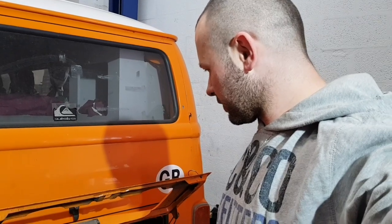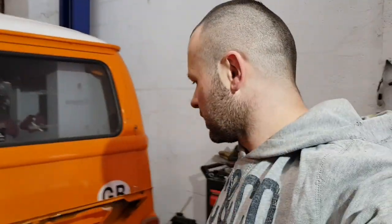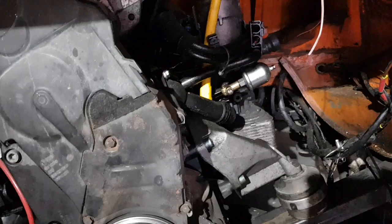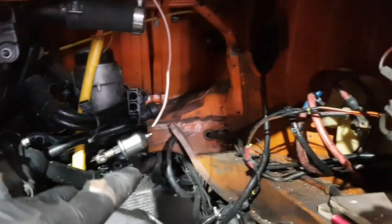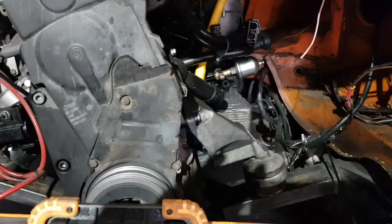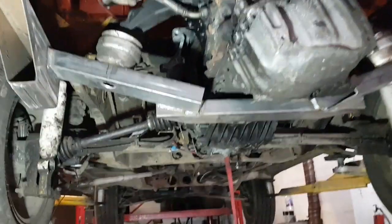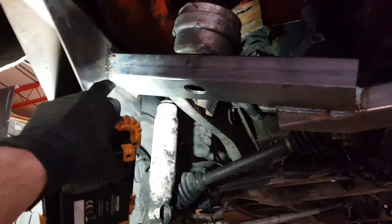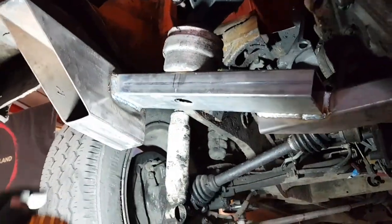So far so good, everything is nice. The only thing - and it's not really complicated - is the few items we have to modify. I didn't put it back, you can see it's all empty there. I have the engine mounts and I still have to build a cross member to reinforce the chassis, because I removed the original cross member. From underneath it looks very simple. If I had to do it from scratch I'd build the mounts slightly different and smaller, and I might chop off the unnecessary section and put a plate underneath to make it look better.